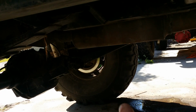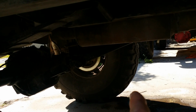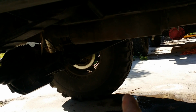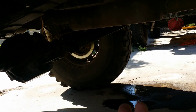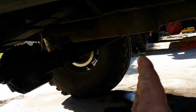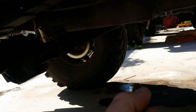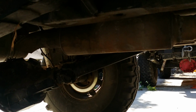Somebody got killed somewhere. I seen it online here in Florida, but the guy got a Jeep stuck. He had exhaust like this. He walked out, left his wife sleeping in the Jeep. He came back, wasn't good. So if you ever do a turn down like this on your Jeep, always be aware of it. Don't leave the windows up and the Jeep idling stuck in a mud hole and let somebody sit in there, because it will get inside the Jeep, which is why they run them out the back. So I just wanted to add that in.